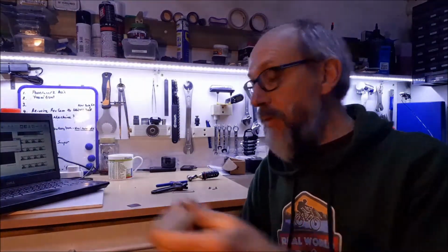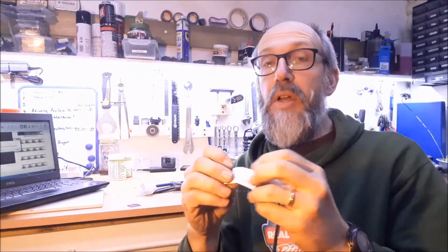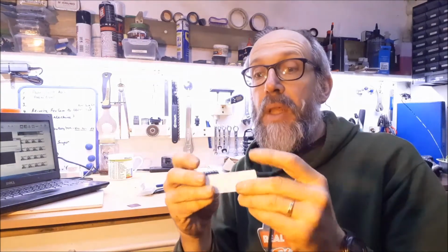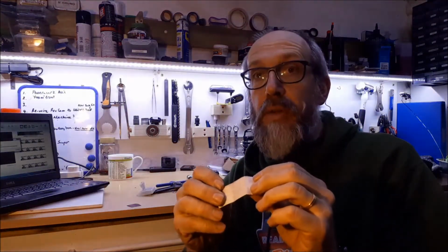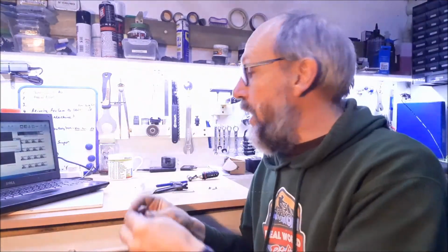And then inside there, really small, I've got a set of little stickers. Literally it's like plasters for tyres, or plasters for inner tubes. You can put those on and stick them over your holes. One tip with those is if you can partially re-inflate your inner tube, then I would definitely do that. Partially inflating it means that when it expands, it's not going to try and pull itself off or pull the sticker off. So those are the first two bits of kit. Okay, next up.